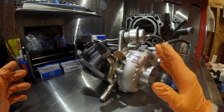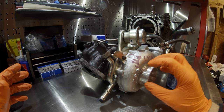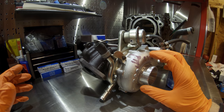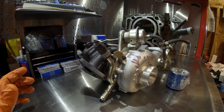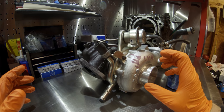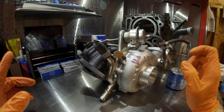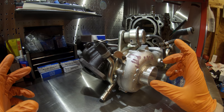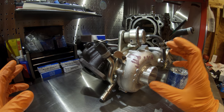If you let the turbo go out, you might not just be replacing a turbo — you might be rebuilding your engine. When these turbochargers die, it can put metal shavings and trash back through the drain into your oil pan, pick it up and go through the engine, wiping out rod bearings, main bearings, scoring pistons and cylinders. Then you're looking at an engine rebuild and a turbocharger replacement. Cheap, effective preventative maintenance: change your oil frequently and on time, change your filter, and gut the screen on your banjo bolt or replace it every 50,000 to 60,000 miles. You shouldn't have issues with your factory VF40 turbocharger on EJ255 engines.